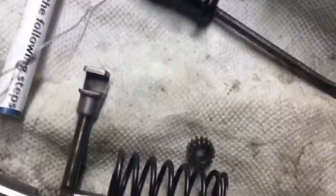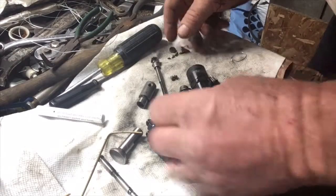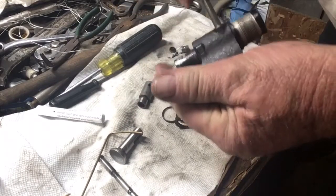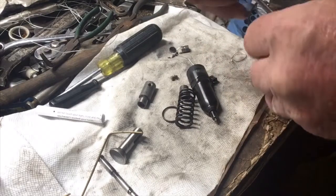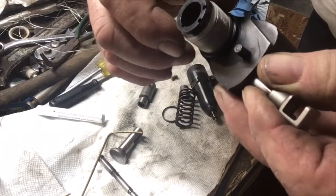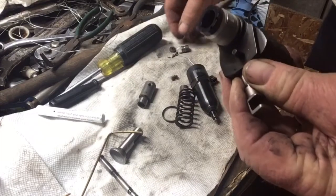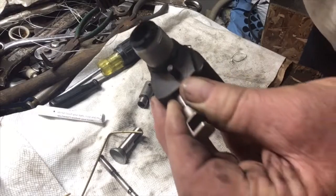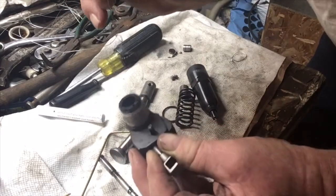And you'll see some of my highly specialized tools I made. This is my specialized tool I made to hold the gear to set it in. So I'll put the rack in. First I got to put it in the right way. There's a groove in this bore, and I lined the two timing marks on those two teeth, one on each side of that groove, so that helps me to guide it in, because then as I put it in, the tooth with the timing mark will line up with that gear when I drop it in. So let's see how it goes.